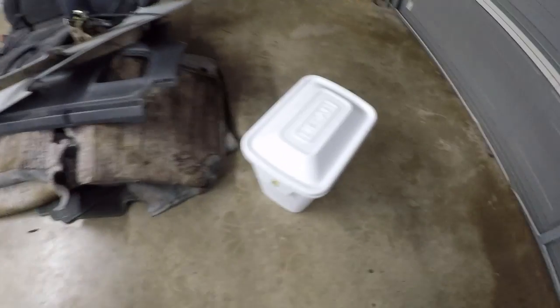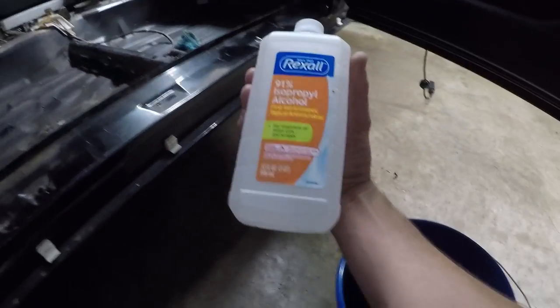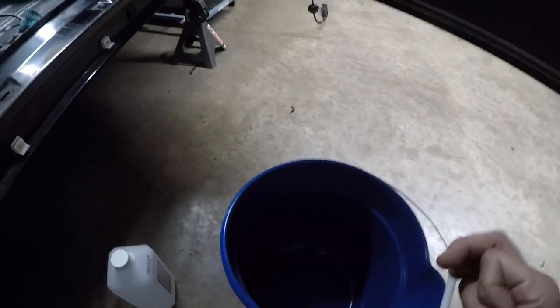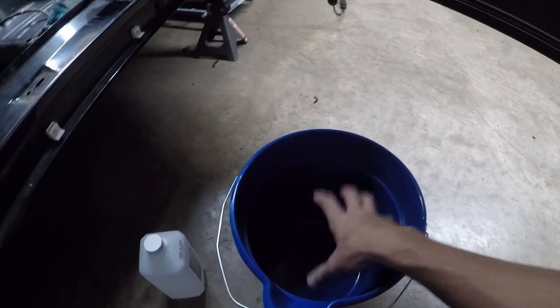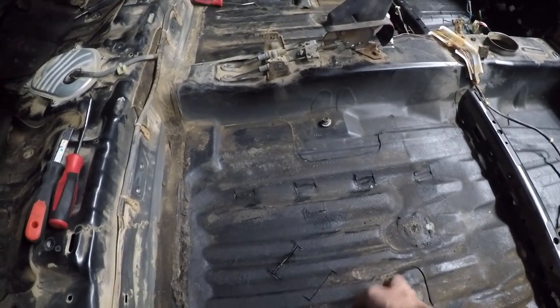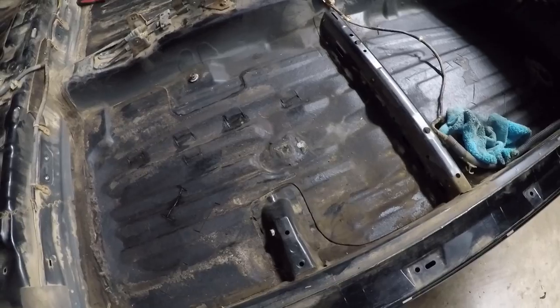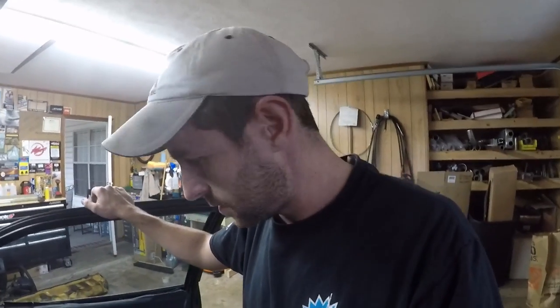We've got what the grocery store said is 24 pounds of dry ice, which should be a little overkill for what we're trying to do. Then I've got a bunch of alcohol — the goal is to crush up the dry ice into tiny pieces, almost like a dust if you can, then mix alcohol with it and turn it into kind of a paste and spread it all over the sound deadening material. It should start cracking, which means the tar is freezing, and then it should just pop right off. I've never tried it, but I think it's going to work pretty well. Hopefully we have enough dry ice — I know I definitely have enough beer.